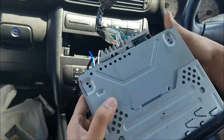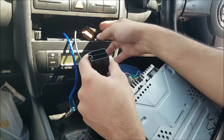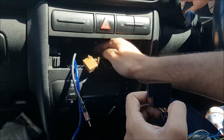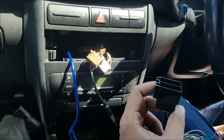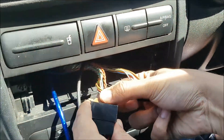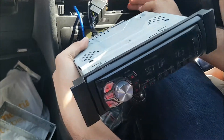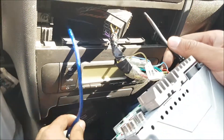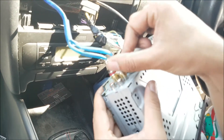On the wiring harness you'll have one which has lots of wires and one which has fewer — just match that up to what you've got in the car. I should also point out if you've got a CD player that came with the car, like I had a six-CD changer, then there's another one of these harnesses in there for that, but we don't need to plug that in. The brown one is going in here and the black one matches up to the wires in there, so I'm just going to plug that in — and we should have power, yes we do. Your radio antenna is this one, so that slots in there. My subwoofer is no longer in the car because we've got a pushchair in the boot instead, but we'll just wire it up in case Rahim grows out of using the pushchair.